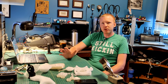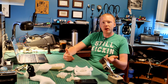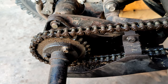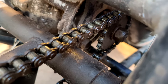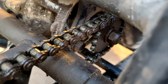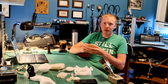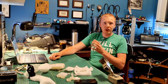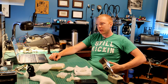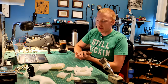My thought is that if I gear down the four-wheeler, it should be able to haul more weight more easily. The first place I looked was changing the sprocket and chain assembly to gear it down, but the spare sprockets I had didn't match the spline fitting on the axle. Without serious grinding, metal cutting, and welding, I figured I'd look somewhere else — and that's where today begins.